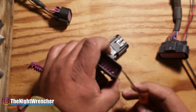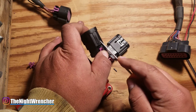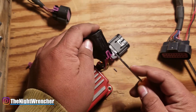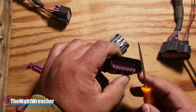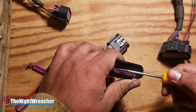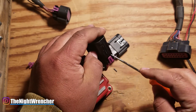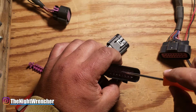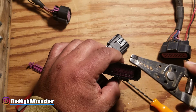So you've got a couple of different options. You can probably drill a little hole right here toward the bottom and then with a pick push the little retainer up — same thing on the other side. Another option is to get a pick that has a 90-degree bend or an S-bend and try to fit it inside one of these holes to lift it up. Drilling out the two holes would probably be the easiest. They don't have to be that big, just big enough for the pick. If you're working with OEM GM stuff, it should have a little tab you can grab with pliers and pull right out.